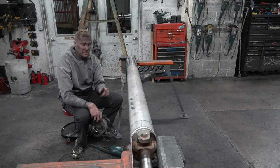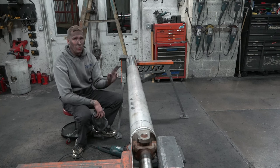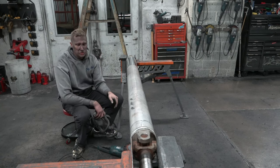If you've watched the previous videos on pressure technique and polishing at 830 to 1030 on your buff, watch and pay attention as I change the angle of my buff every time I go around this thing. I'm always constantly changing my angle.